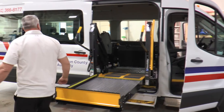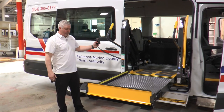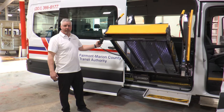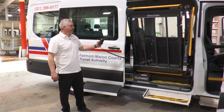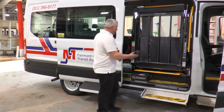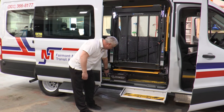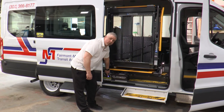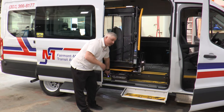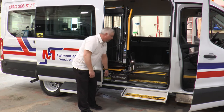At this point we're going to simply use our fold button. We're going to hold the fold button until the Braun lift stops. I'm going to hang the control box on the right side and go back to the shifting step. Push and hold until it stops. This is the preferred position — in case of an emergency you have an open staircase, but this is the preferred position.